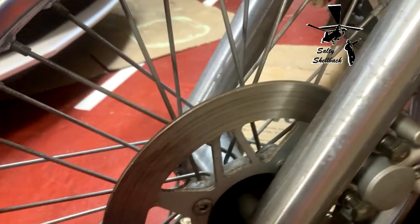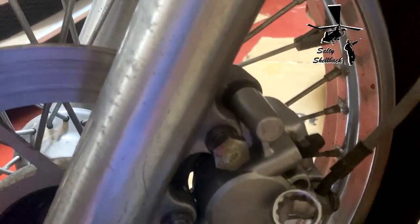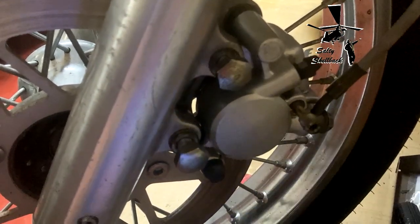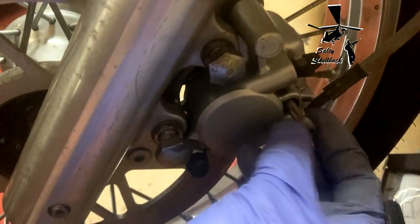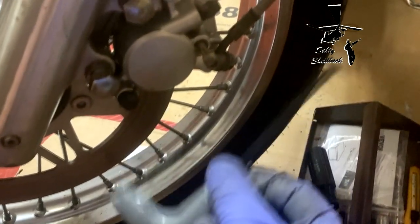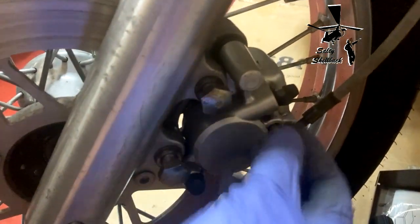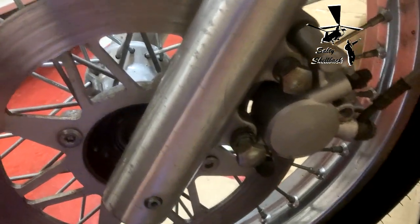From Amazon. The way you take them off, you got two bolts here, here, and here — take those out. You also want to take out the retaining pin. It fits right there. I didn't take it off until I pulled the calipers off, but you want to use a five millimeter allen key or hex wrench — I got a T-handle. Take that out first. Then use your 17 millimeter wrench to take those bolts out.